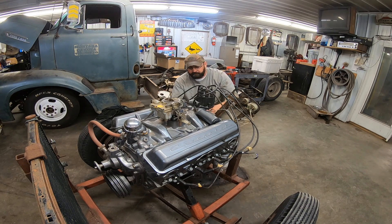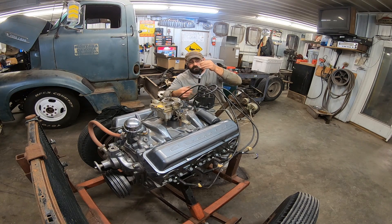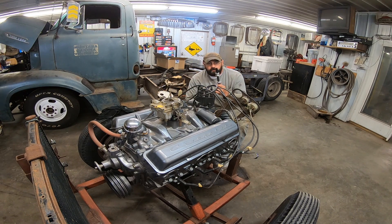We've got our gauge hooked up here that came with the stand. What I've got here is this cute little tool — you can get them on Amazon, eBay, your local parts store. Basically it's a distributor shaft, and it's got pieces of the distributor housing — these two aluminum pieces that basically hold it in place so it's not wobbling around when you're drilling on it. You slide that slot up with the oil pump, run it for a while. So we've got oil pressure and got everything up top lubricated with that oil.